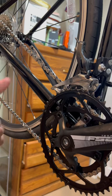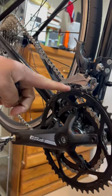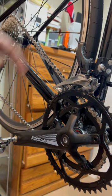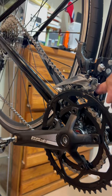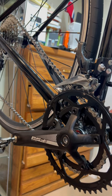We're going to set up this front derailleur in less than one minute. First, shift all the way to first gear in the back, then switch over to the front. You want to set your low limit first — that's the L screw. Set the low limit so that the inner plate is one to three millimeters from the chain.